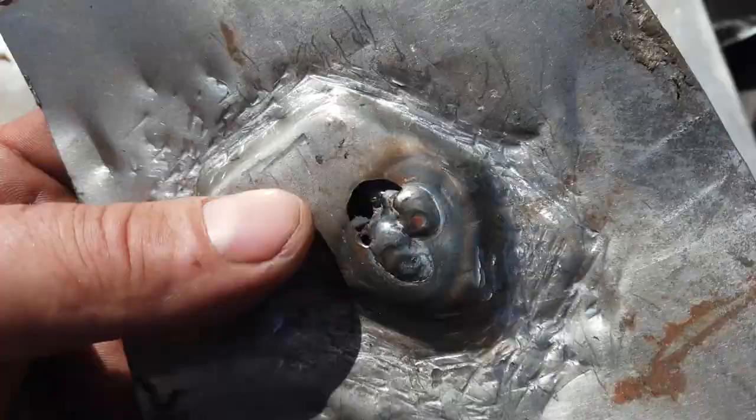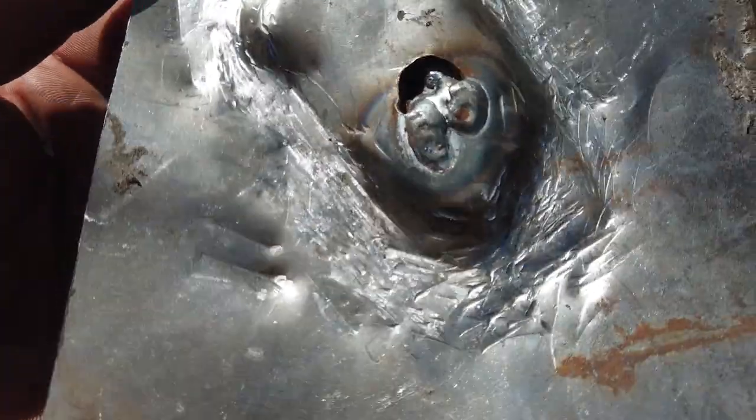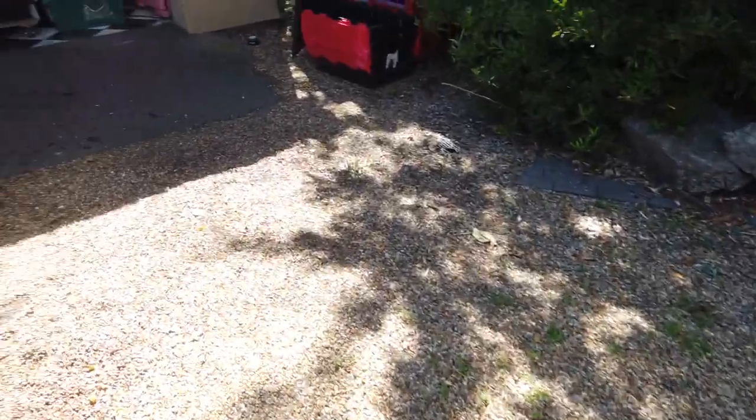There's a scallop to do for the jack to go in - that's a kind of rolled shape - that's a little bit trickier. Little tip for you: if you want to get impressed shapes, get a good attachment to the donor piece and then bash it over it. It's going to give you an imprint. Looks rough at the moment but you'll be surprised how much better this looks in a minute when we're finished. I'll draw this on the back then cut the piece exactly the same shape as that.